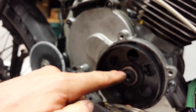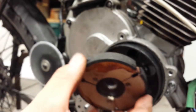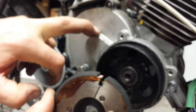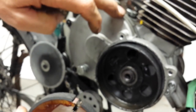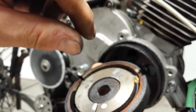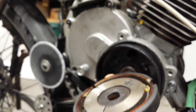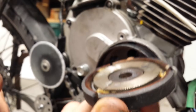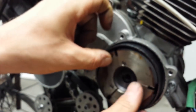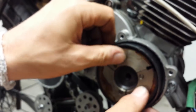If you don't file that area flat, the clutch shoes will attach themselves onto the extension sleeve, and it will be very difficult to get them off. If for any reason you need to wind up the flower nut to get more preload on the clutch to stop it slipping, you have to remove the clutch shoes, remove the clutch bell, and remove the extension housing. I do a few test trials placing the extension sleeve into the clutch shoe area so I can confirm the shoes come out without any drama, because if you don't, it becomes a near-impossible job.